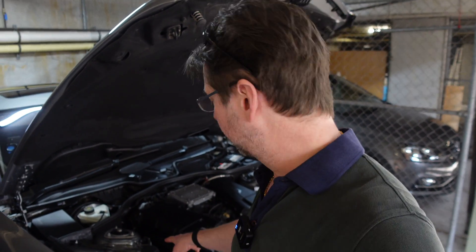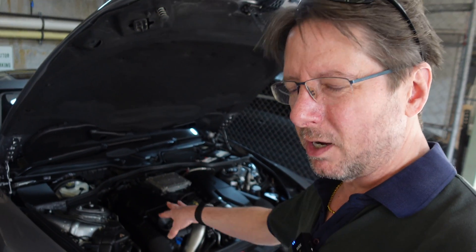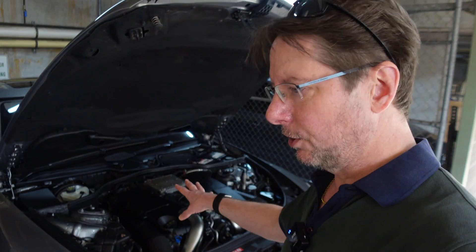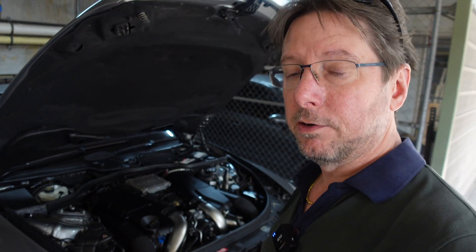What I've done on this car is actually replace both turbos. Whilst it has improved the rattle considerably, it's not completely gone. Even with the brand new turbos from Garrett, there was slight movement in those bearings, and that is obviously to allow for expansion. If those bearings were tight when they were cold, they would seize up when they expanded in the heat — and it's one of the hottest parts of the engine. The turbos are completely fixed onto the exhaust manifold, so there's a huge amount of heat variation cycling up and down. It has to have that bit of play in the bearing or else it would seize up.